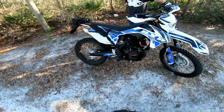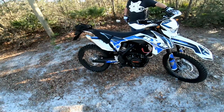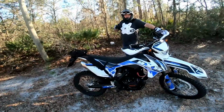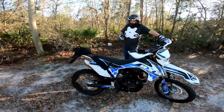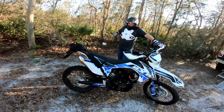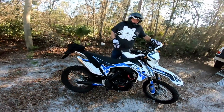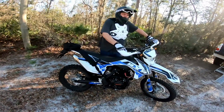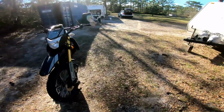Other than that, I just dropped one tooth in the front and dropped to a 38 in the rear. I'm probably going to jump one tooth because it'll do over 70, about 75. I can cruise at 60. Really? With the other gearing. But off-road, it's not that it doesn't have enough torque. I want to be able to chug at a lower speed. And there was a little more clutch work, and I was noticing clutch fade because I had to beat the clutch. Right.